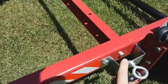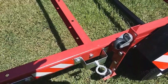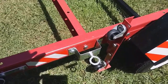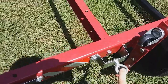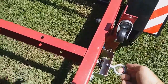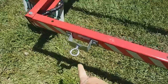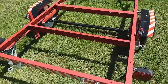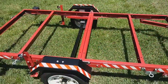These rail holders come with the kit in case you want to add side railings and make a deeper trailer. I recommend installing them even if you don't plan to use railings. At Lowe's or Home Depot you can get these little 3/8-inch loops and attach them to the rail holders — I got one for all eight of them. For tying down your kayak, mulch, or anything else you plan on hauling, that's a good idea.